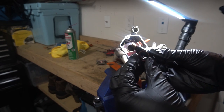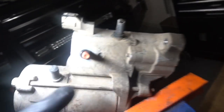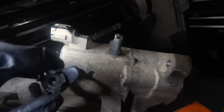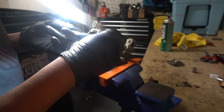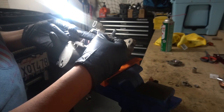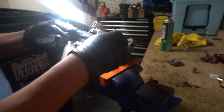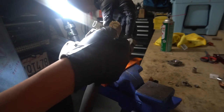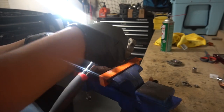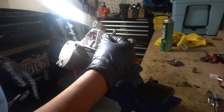Put that o-ring on before you put it on. Let me show you the back side — there's a notched-out hole that lines up with this hole, so when you put it on you can't do it wrong. This guy with the new o-ring on the outside — make sure it lines up with that hole I mentioned. Just push it down and it kind of holds in place. Then the washer, and then the new nut. Tighten it all up — 14 millimeter. On this side, that stud-looking thing should press itself in quite nicely once it gets tight. Just snug it — that should be good.